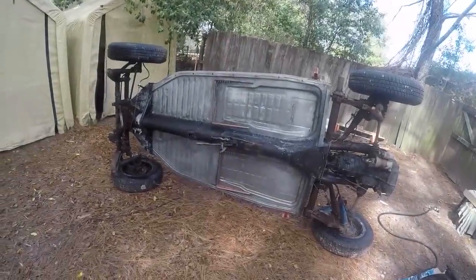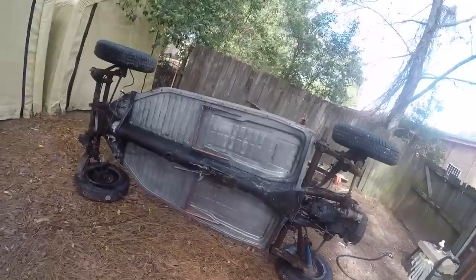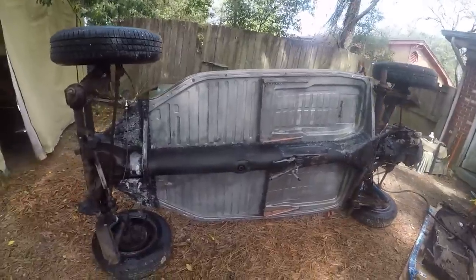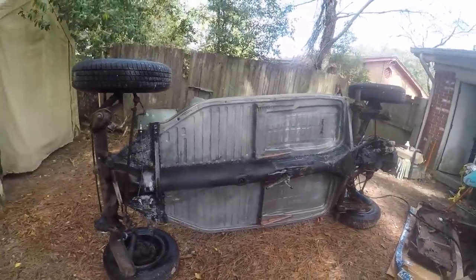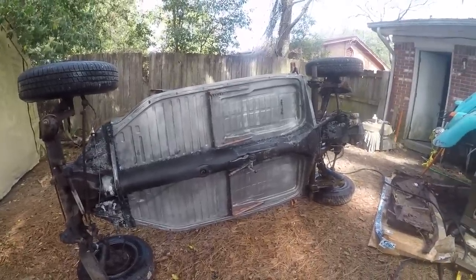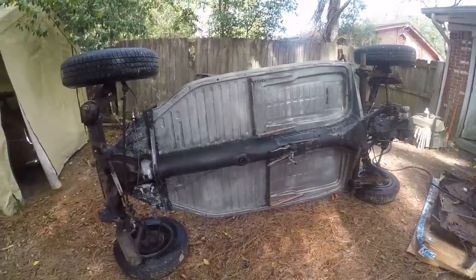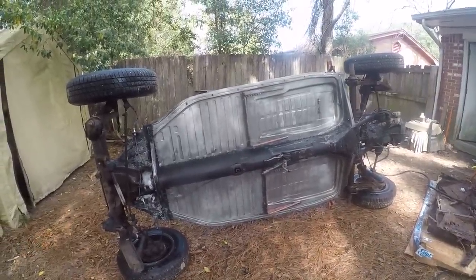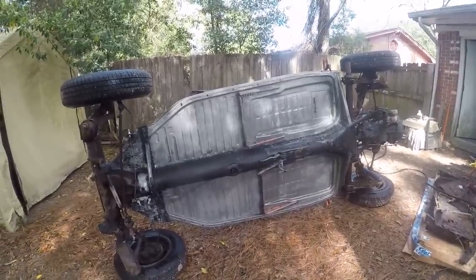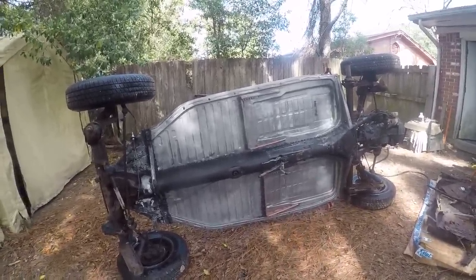The pan is turning a little green. I don't know what reaction with phosphoric acid would turn green — maybe there's a little bit of copper in there or something. I'll have to do a little research and find out myself. Looks good to me. I did hose it real quick to get off some of the phosphoric acid residue. If you leave the residue on there, it's kind of sticky and paint will not stick to it — it'll actually just slide off. The water will take the acid away, and then the water will dry, and it'll dry a lot faster.